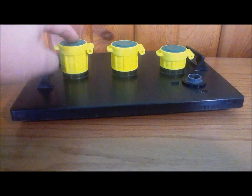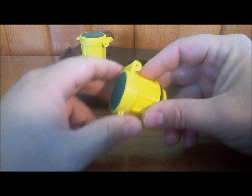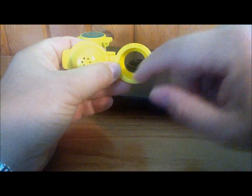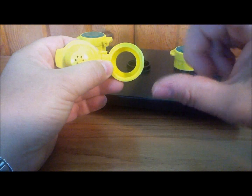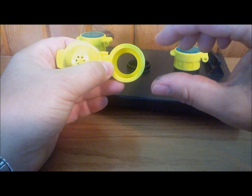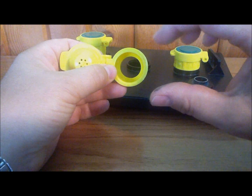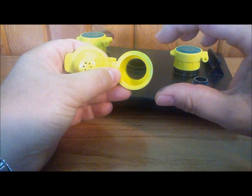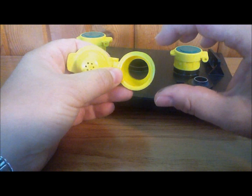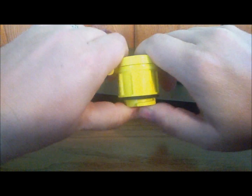The medium height cap is configured a little bit differently than the other two. The inside of the cap, as you can see, has no baffle in there, and I'll grab one of the other ones in a second and show you. Without the baffle, the opening is bigger and it's easier to see inside and easier to water your batteries. This is preferred a lot of times by people with golf carts or RVs, who have to water or check their batteries in an already confined space, like a golf cart, or a battery storage area in an RV. So the medium height cap is by far the one that is used most often with RVs.